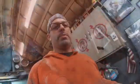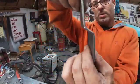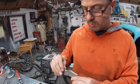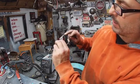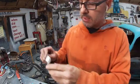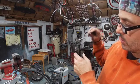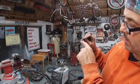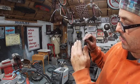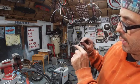Alright, so I got these bent right in the way they should be. Really close. Which again, I can use my template. I actually bent it a little smaller, which is actually fine because I want to take the bottom edge that goes underneath the roof, and I actually want to bend it down so it slides in and then adds pressure as it goes in. So I want to almost curl it down right at the end.